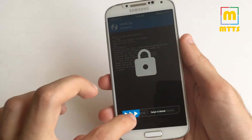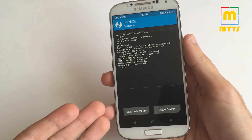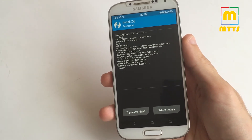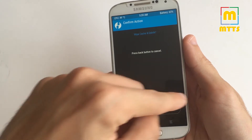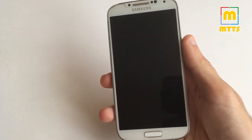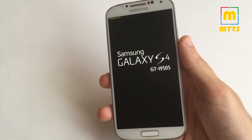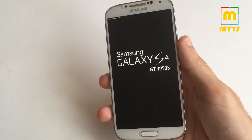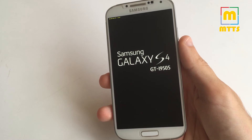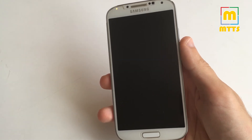After installation you will get to this part. At this point you should wipe cache and Dalvik by swiping here, and only afterwards reboot the system. Of course, if you have an OpenGApps package you should install it right after the ROM installation, then go through with the Dalvik and cache wipe, then reboot and you're good to go.